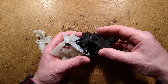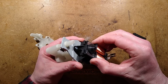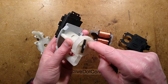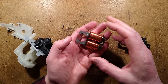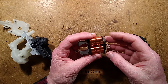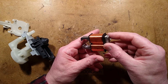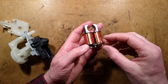Let me show you the motor — I've unclipped it off the top. Here is the motor and it is a synchronous motor. This is quite hard to pull out because there's a powerful magnet in here. Now it's turning freely because the magnet is in here and there's no stator around it anymore. Here is the actual winding in the motor — it's got a dual winding. I wonder if the reason is for different voltages or just a convenient way of doing it. The winding goes from one end to the other, links across, comes back again to the two spade terminals.